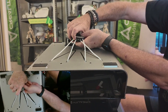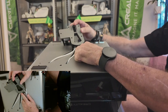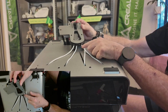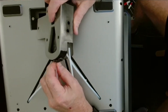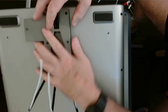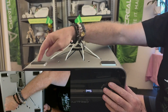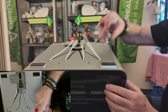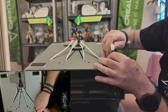When you get this out you just have to push — it's just like a normal bowden tube — you've got to push these little bits in, and they just pull out like so. Once this is out, we've got to undo these four screws and that'll let me pull it out the other way. These attach to it, so that's why you have to undo these — it's going to be the same length screw.